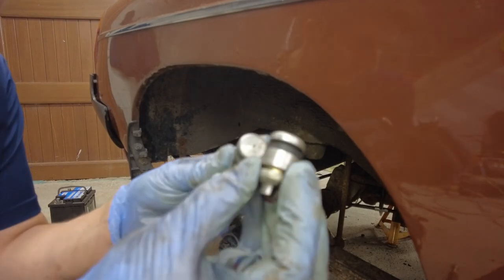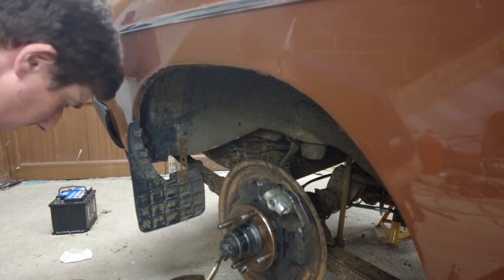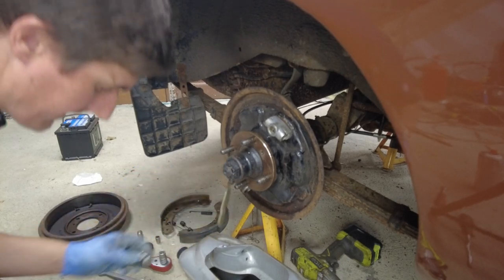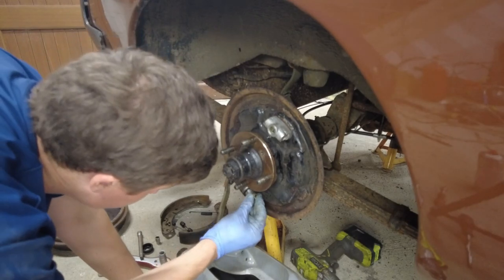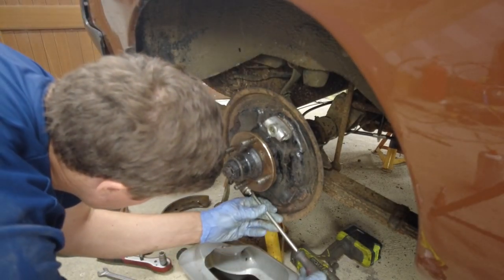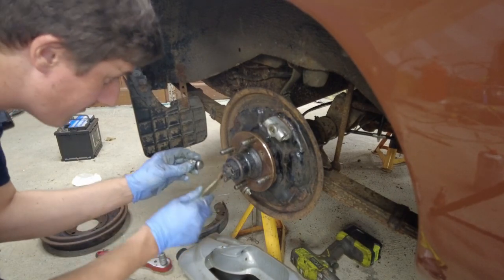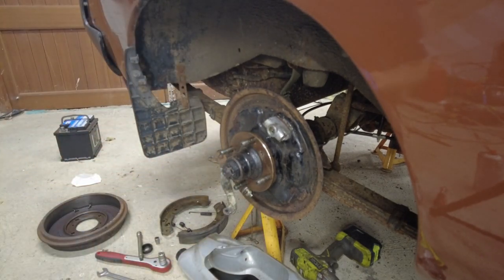They're looking a hell of a lot better now - I'm happy enough to refit them. The first thing I'm going to do is pour a little bit of brake fluid over each of these and pop them in, then put our dust covers on. I'll show you me putting the shoes in as well. I did free up that handbrake lever too, so that's all done. A little bit of lubrication for the seal - that goes in nicely. Just have to be careful not to fold the seal back on itself when putting these in. I've done this before successfully, so this isn't me taking a chance - if it's not right I'll get a new set of slave cylinders.